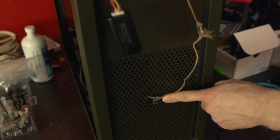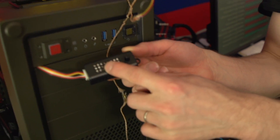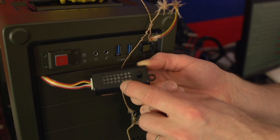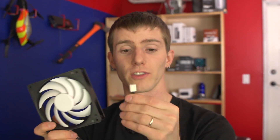We collect our ambient temperatures at the front of the case, log them, and then correct all of our results to as if the room was 20 degrees Celsius. When we're not running fans at full speed, we use a variable resistor to run our fans at exactly 1100 RPM, using software RPM monitoring. However, it should be noted that running PWM fans such as the Helix ones with voltage control could have adverse effects on the longevity of the fan — we're only doing that for the sake of eliminating variables, not because we recommend running them this way.